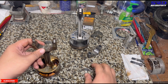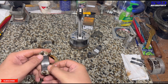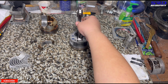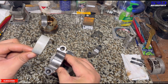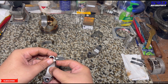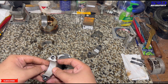The B16 bearing fits just as good as a B20 rod bearing, but there's no oil hole. Locally, that's a mistake that often happens — they're melting pistons, cast or even hypereutectic. For aftermarket rods that use forged pistons, you can still use the ACL B20/B18 LS rod bearings. The bearing has a hole but the rod is closed, and that's perfectly fine.